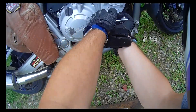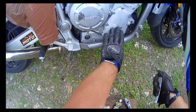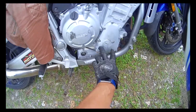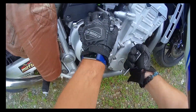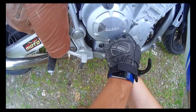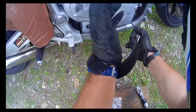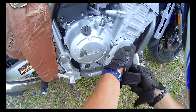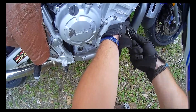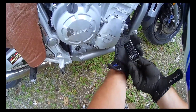The bike's a little dirty but we're going to find the timing cover first. Basically this is your timing chain and ignition cover — this cover right here for your timing plate. There are eight bolts on this that have to come off. If you're really careful, you'll never actually have to break the gasket. I always keep a little bit of black silicone on hand — I've used it on all sorts of bikes, oil-cooled, water-cooled, injected, carbureted — and it works great. Get this cover off and we'll expose the spark plug timing plate.